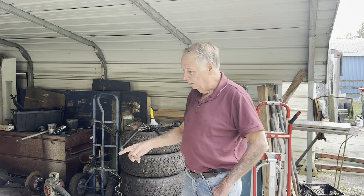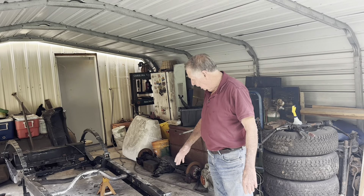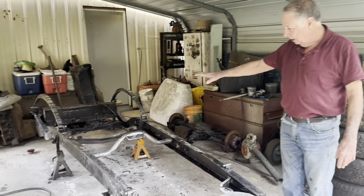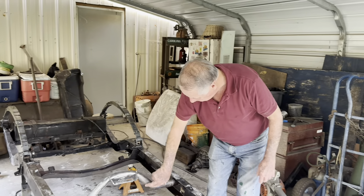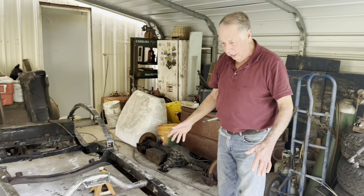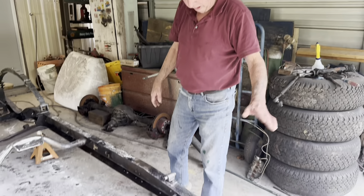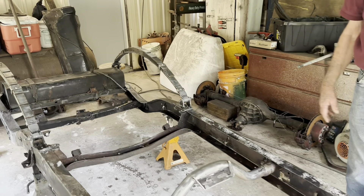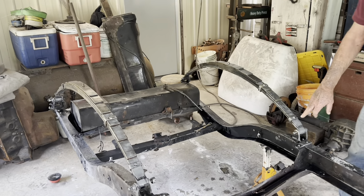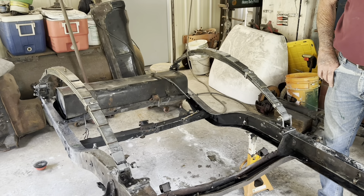Last time we talked about the frame on this new car I'm going to build, the '28 Delahaye. Since then I've wire-brushed the whole bottom of the frame. Now I can see the places I missed and I'll go back and get those. I sprayed Ospho on it to kill the rust and keep it from rusting. I did this about three days ago — sprayed the springs with Ospho too and they're not rusting either.